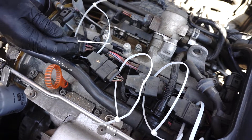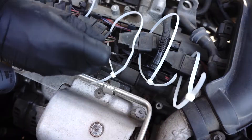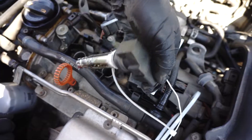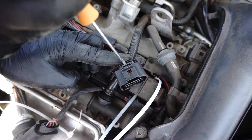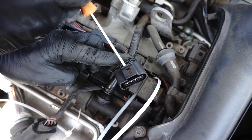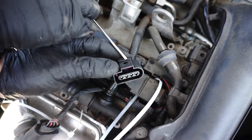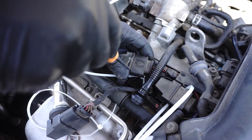The wires are too short — make them longer. Good, now remove it the rest of the way. The plug looks like that. We have to press it here to release it. To help yourself, before you press that arm, push the plug towards the ignition coil to remove stress from the hook. Great!